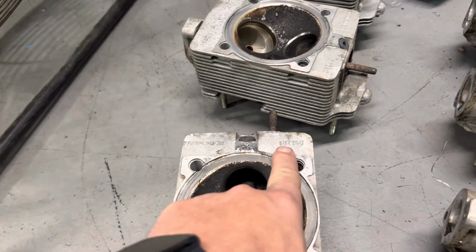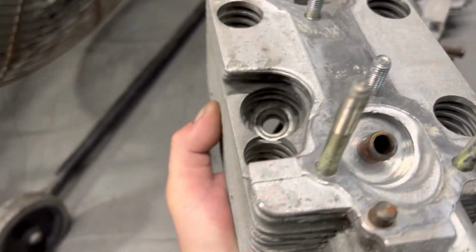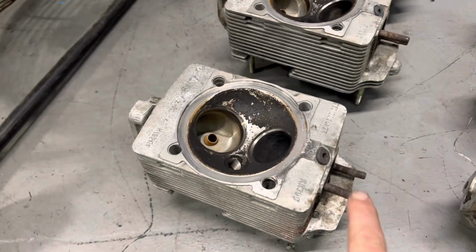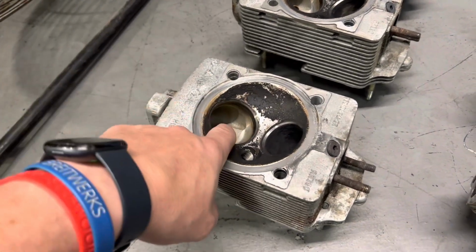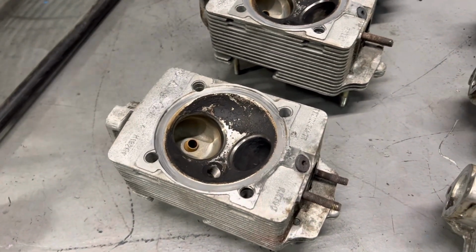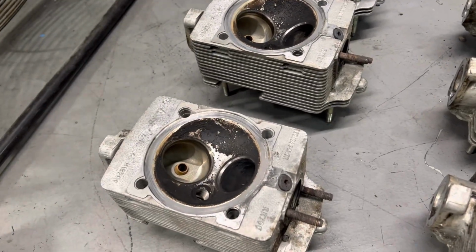These are the RR350 heads, right? That's what makes the 930 heads special. So we've got them completely disassembled. I don't think there was a good exhaust valve guide in the lot. So these heads will get new studs on the exhaust side. We keep the intake studs, new guides, and we're going to do some fancy stuff from a porting perspective. But yeah, heads are ready. They're going to go out, and that's one of the long poles in the tent.